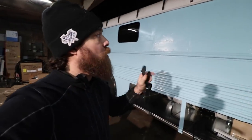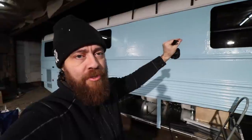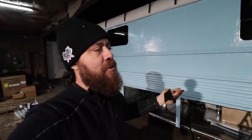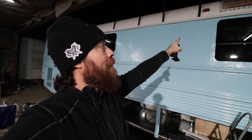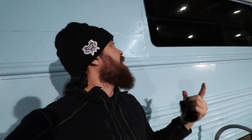Even though the windows didn't have problems themselves, this one right here on the top edge — we had to use a little extra weather stripping because our DIY skin wasn't the flattest, being roof material. If we had used thicker brand-new sheet metal we probably wouldn't have had the ripple effect, but because of that we had to use extra weather stripping on that corner. I was thinking if we did a bead of caulking from the bottom edge up around the top and back down, that should allow water to drain off and not penetrate. There's room between the glass and the skin to put a covert bead of caulking there.